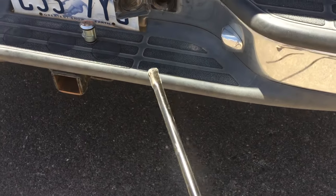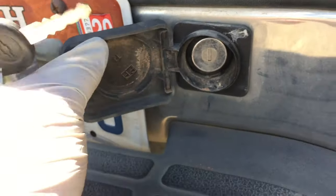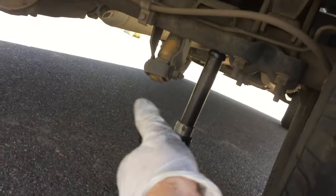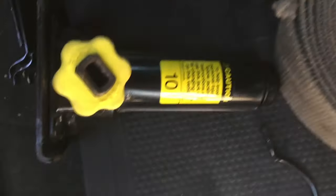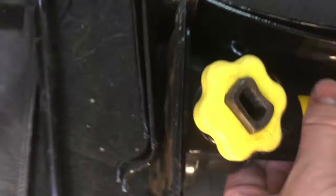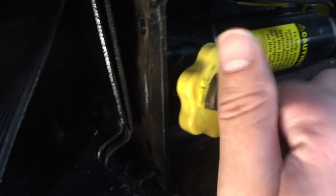Next, we're just going to remove the pole here. And if you want to, reinstall your key — honestly, I'd probably just end up throwing this thing away; I don't think anybody's going to steal your spare tire, but you never know. Then go ahead and start lowering this down, just the opposite of before. Remove the wheel chocks once it's all the way done — there's one on the front of the tire and one on the back. Then put the bottle jack together: take the little clip here and it's going to go around the base of the jack, with the jack handle facing you. Have that go up through the hole of the wheel chocks and tighten it down with the wing nut. It just goes into its place — scoot it in, and then as you tighten the jack again, open the jack up, and it will wedge itself back into its place.